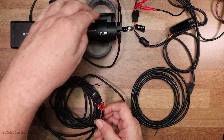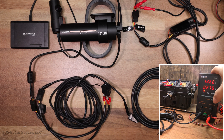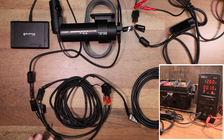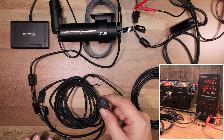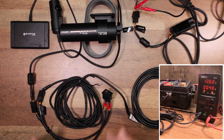This pigtail runs out to the camera normally mounted on the front windshield. My simulated fuse box represents the dash cam battery pack, and my power supply is acting as the car's charging system and battery. I've configured it at 12.6 volts at 2.75 amps max — it should take less than 500 milliamps to power this whole system at normal operating power. I've begun sending power to the system with the simulated ignition switch in the on position and my extra power switch turned on. The camera sees no difference and boots up normally, receiving power, accessory, and constant power from this cable set.